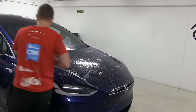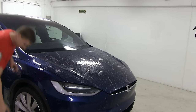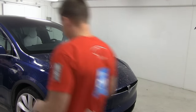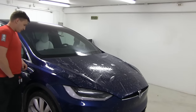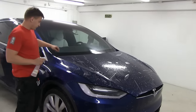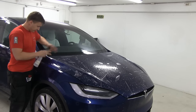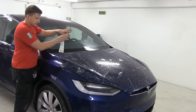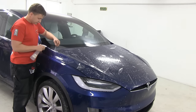First thing we usually do is go to these corners and try to get the exact position. Once we're here, we're gonna use our tack solution, which is alcohol with water. I'm gonna try to find approximately the right position, how the pattern is cut away. And I'm gonna tack this material here so it doesn't move, so I can stretch the material all the way to the other end and try to find the right position as well. So don't need too much.